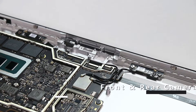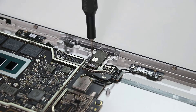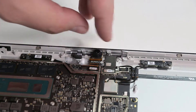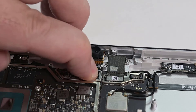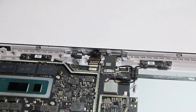After cleaning the rear camera lens with a microfiber cloth, use your fingers to gently place the rear camera into the chassis and secure it with two 3IP Torx Plus screws. Place some new thermal material in the same location you found it before, and then place the front camera into the chassis. Using your finger, press down to reconnect the front and rear camera cables to the motherboard, and then clean off any fingerprints or smudges on the front camera with a microfiber cloth.